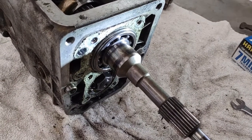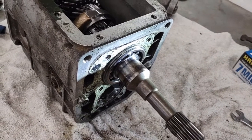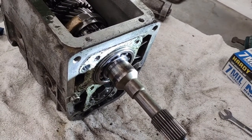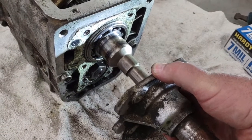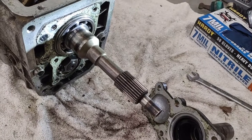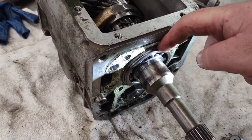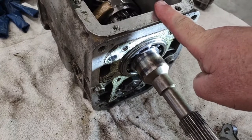So where do I go from here? I have another box or two. I'll get to those boxes and check out their spacers and this fit. If the fit is the same in all the boxes, that's saying something — either they're all worn or it's meant to be that way. Until the case goes tight against it, it doesn't hold the bearing in place. Either the spacer wasn't the correct size, allowing the bearing to spin, which caused failure. There's too much play there. I'll have to figure out if the outer ring can be exchanged from a different box, or if it's part of the casing and I'll just swap the casing. More investigation needed.